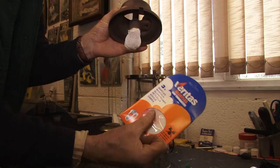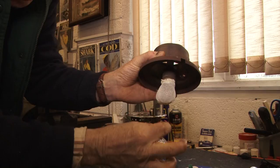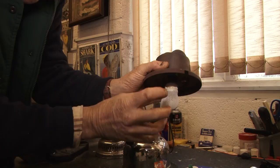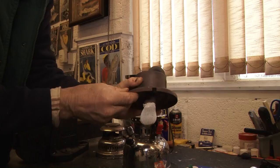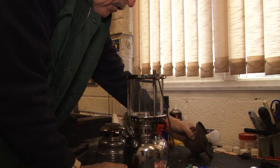Looking down the center here and lifting it right out — you should be able to see in the circle there. This is unbelievably fragile. It does unscrew from there. When you first get them they come like a piece of cloth — you can see that pink material — this would all burn off. You've got a little couple of drawstrings around the edge. It hangs right down as a loose pouch. When you burn it off with meths it all shrivels up and makes the mantle, which is where all the paraffin vaporizes. It's your light bulb in effect.